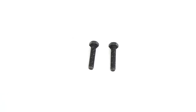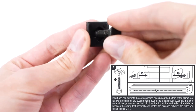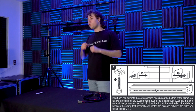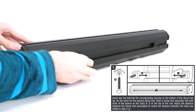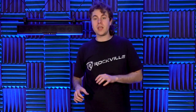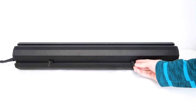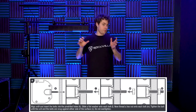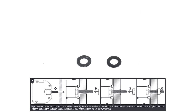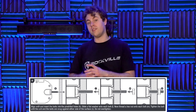Then use a drill to make holes where you've made your marks. Next, take two 25-millimeter hex bolts and run them into the opening on the bottom of each clamp foot. Once you run these through your clamp foot, slide each clamp foot to each side of your speaker. You should be able to slide these along your speaker so the bolts can line up to the holes you made. Line the bolts up to the holes and run them through, then take a washer and hex nut and run them through each bolt, tightening until snug on either side of the surface.